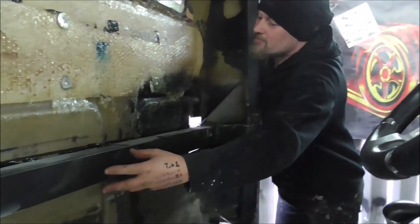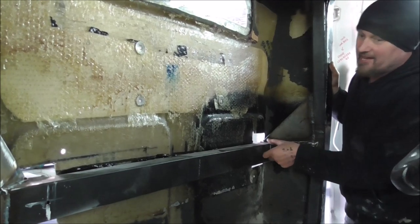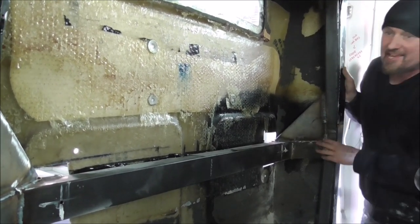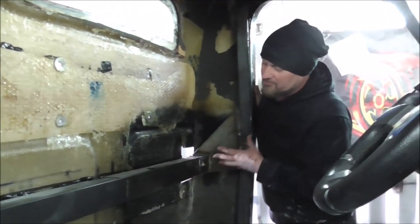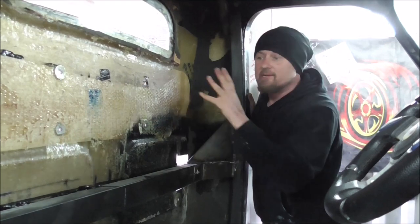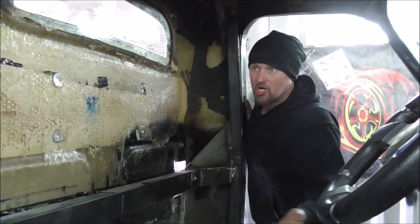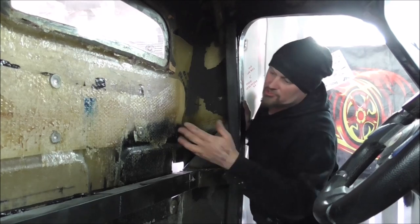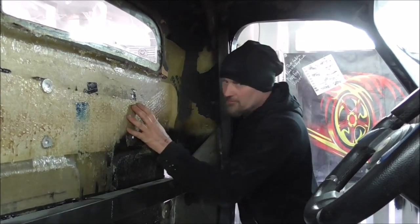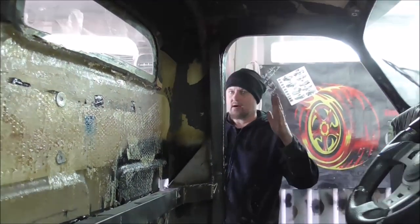So what I've done, I've bought this piece of 3x2 steel across here, mounted it in here, put these two large gusset brackets here, and this is all seam welded and this is bonded to the back of this, and already this is starting to feel a lot more rigid, a lot more car-like, rather than just being a flapping, like, unbraced piece of plastic. So we've done that, and also at the back